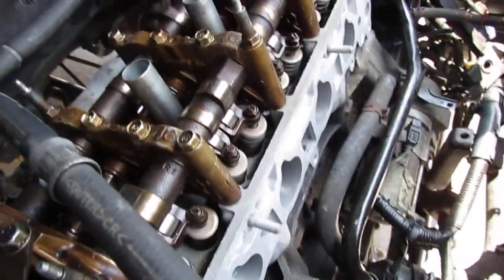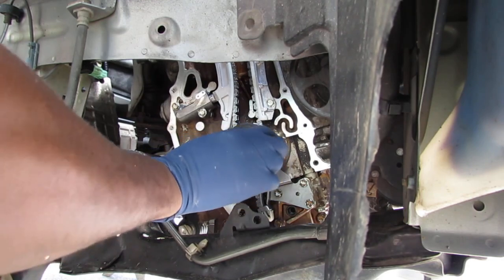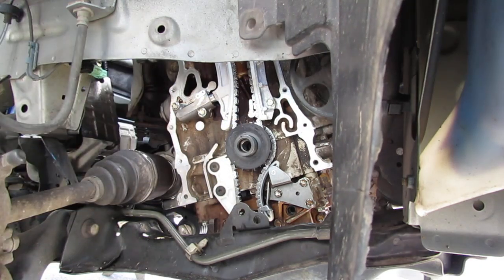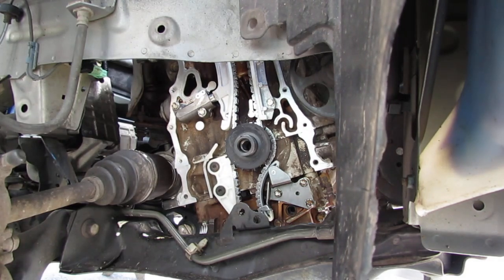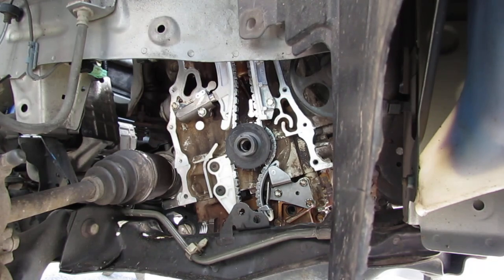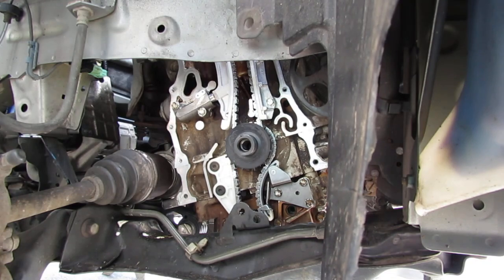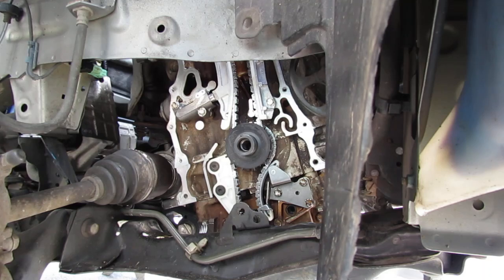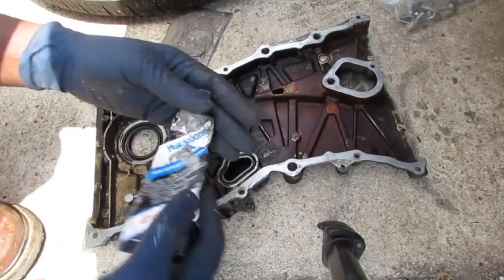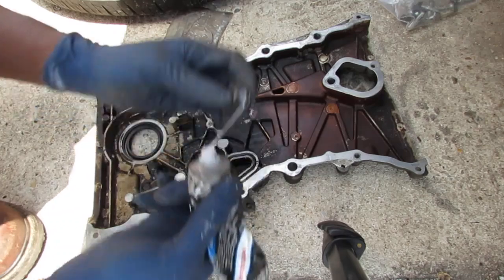It is a breath of fresh air. I feel so relieved. This crank position back. It's like a tone ring or something like that. It has an outside mark. Make sure that is on the outside. And so now we're gonna put the engine side cover on, but you gotta kind of rehearse this because it's time sensitive. Rehearse how you're gonna put it in. Make sure you have everything lined up. All the bolts you need just to catch it because you're gonna have to put some RTV on there. So we're gonna use Honda Bond number 4. And there are some specific places on this cover you wanna put this RTV.